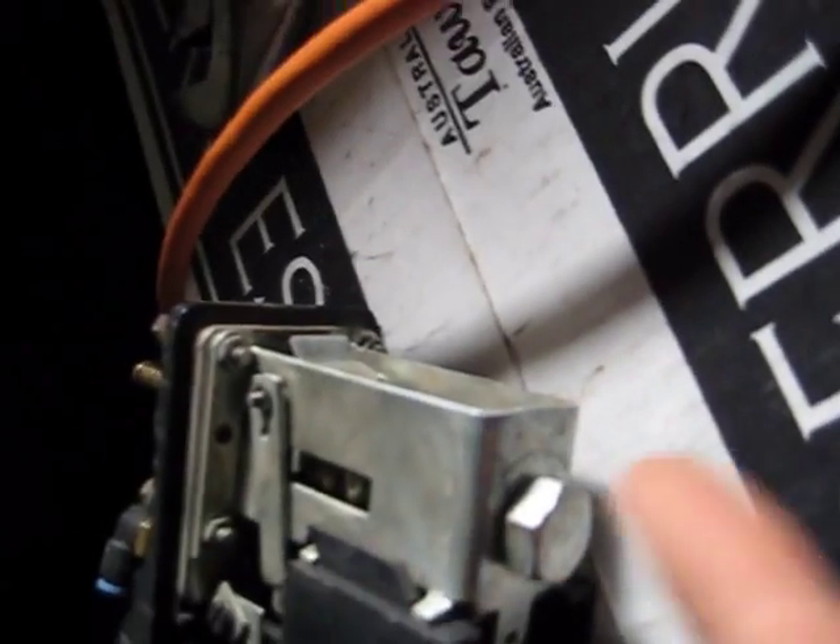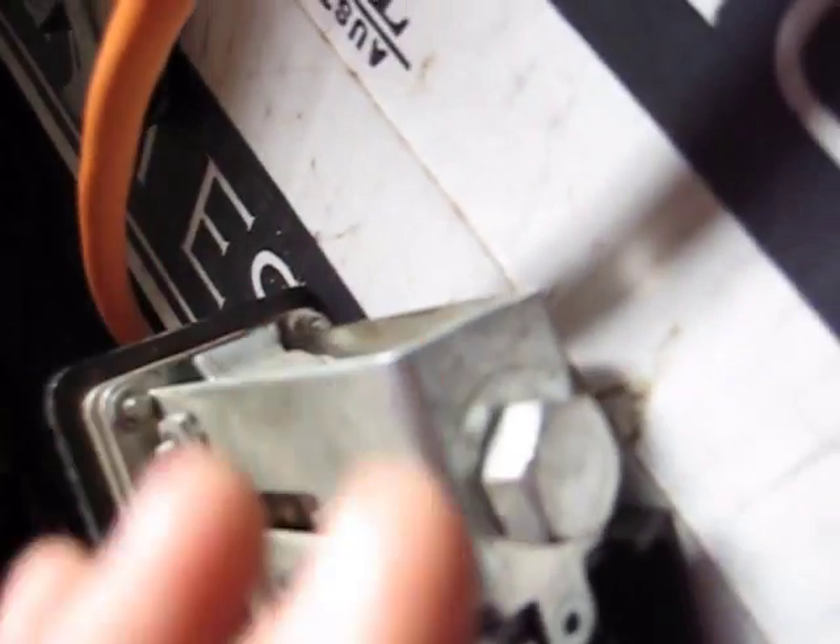Just been looking around on this. We've got a negative - drops of pressure - I think that's the cut in and cut out. Or the other way: it drops cut in and cut out pressure. But turning it up positive this way - which is clockwise, I believe - increases the cut in and cut out pressure.